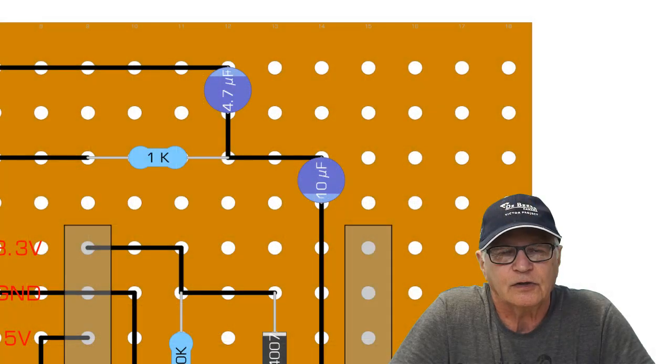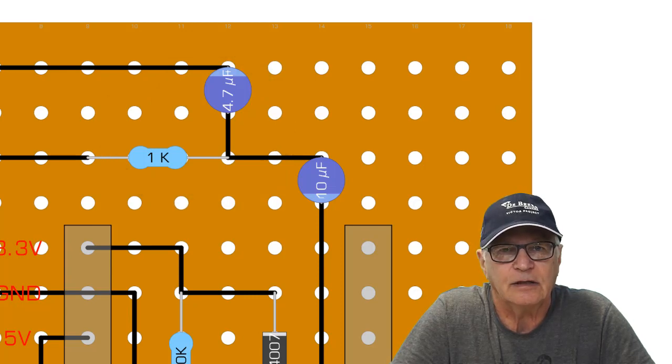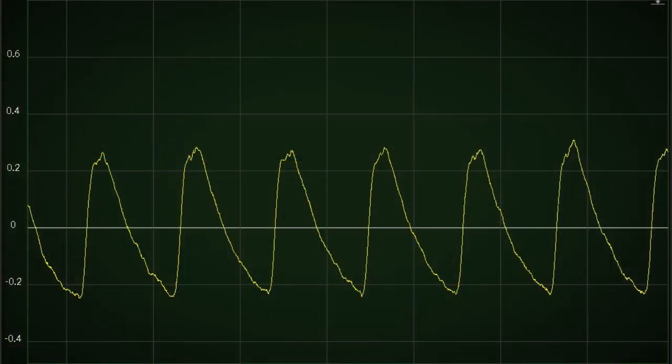On the front end of our circuit is a 33 Hz RC low-pass filter. It's designed to block frequencies above that and allow our very low relative compression waveform through, which is maybe 10 to 15 Hz depending on the engine and crank speed. The end result is a pencil-thin relative compression waveform.